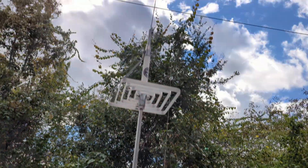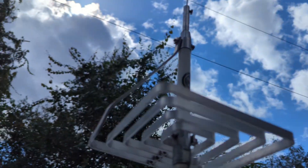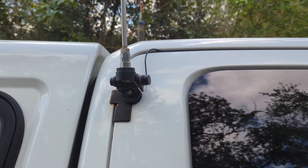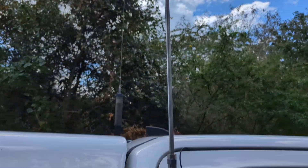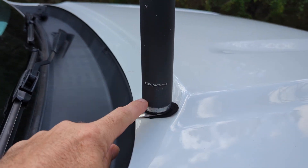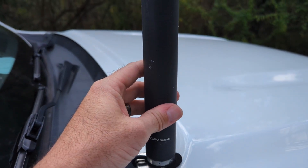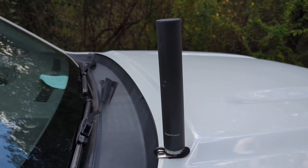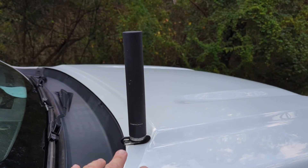With this one on here, you've got about 30,000 miles on this antenna on this vehicle, and you can see there are even some bugs and carcasses, but this antenna is used, it's been beaten, and it works with a flawless SWR. I talk on 11 meters all over the country and the world on that Perfect CB antenna. Next to the Compact Tenna you have this little guy — this is still hanging on. It's a cheap trunk-lip mount but it stays on. I use this for APRS and a scanner, and it works great for VHF/UHF ham radio dual band radios.